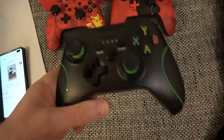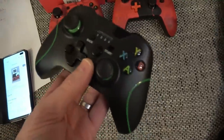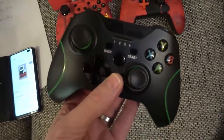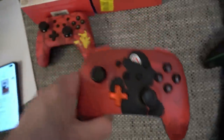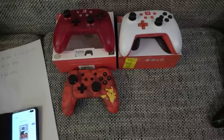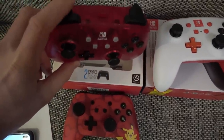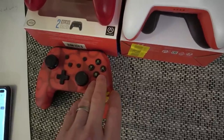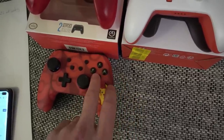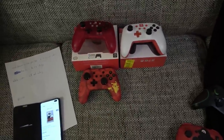Unfortunately this one can't be fixed because it's for the Xbox One and you need a separate dongle. It's a wireless controller but you need a dongle to plug it in - it doesn't sync directly to the Xbox. So I can't fix that because I haven't got the dongle. This one here I cannot find any fault with whatsoever - every feature is working. And with these three here, luckily I have got faults. This one has the L and ZL not working, this one has the ZR not working, and this one has two sticky buttons A and B - although they work, they're not as responsive so they need to be cleaned. Let's get them over to the blue mat and see if we can fix them up.